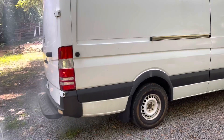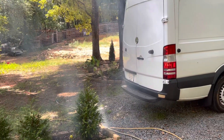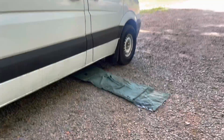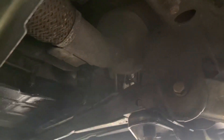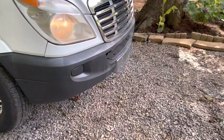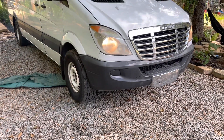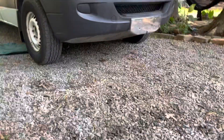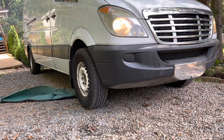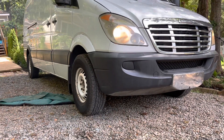I am regenerating this 2007 Sprinter. As you can see, lots of nasty smoke is coming out and it stinks pretty bad. Now we're going to crawl underneath. That stuff is just nasty. It's obvious it's coming from the bottom — earlier I went down there and it was a little more clear, but I can certainly smell it. You can see it's all right there where the intake manifold is.